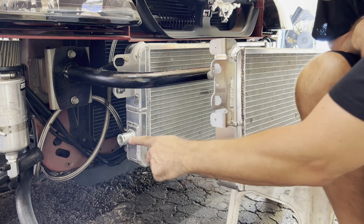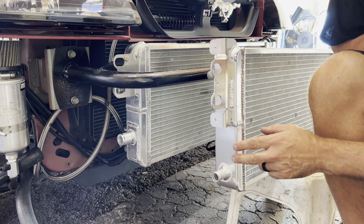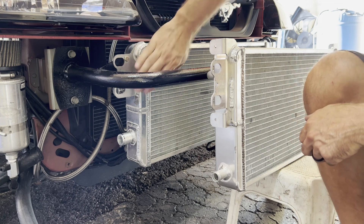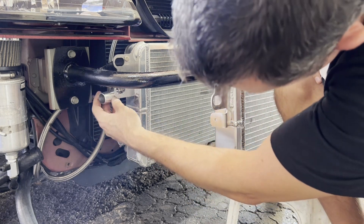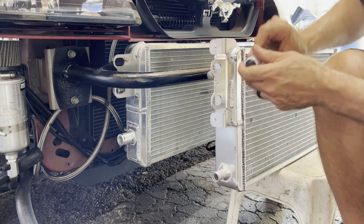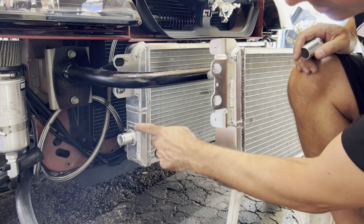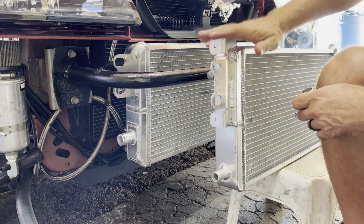Here's a nice side-by-side comparison of a modified unit and a stock one. These are all from 2007 through 2012 GT500s, so even the bracketry is different. You'll notice this extra piece of bracketry has been cut off and removed to create clearance for fitment. The bottom bracket is removed to make room for the new bung being welded in. You can see how the bung position was moved up and a patch panel was put in to cover the original hole.